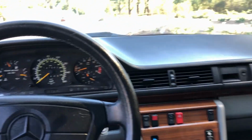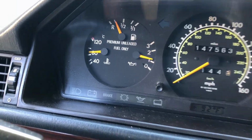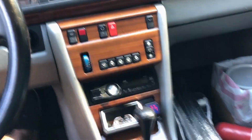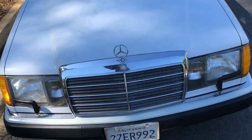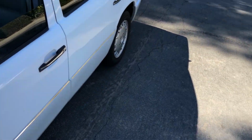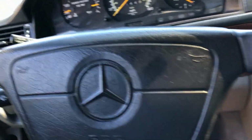Okay, so I've been driving it for 10 minutes up and down this hill here. Temperature is good. Low speed fans are on. Let's see if they stayed on. Voltage is good. Let's see if they're still on or if they're cycling. Yeah, I can hear them. So they're on. Before, the way it was wired, they were cycling on and off, you know? So it totally messed everything up. This is the first time in 12 years where things been working right. Not overheating.